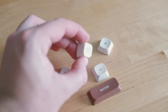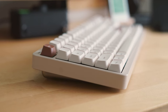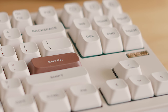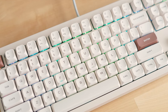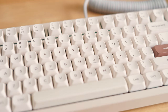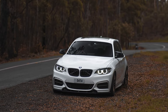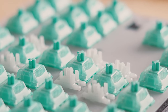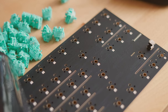But what do I think of the Gem 80? I mean, it's alright — jokes aside, yeah, it's a pretty great keyboard. However, there are a few things to note. The most important to me is the design of the keycaps. Innovation is good, but I think there's been some oversight here. The keycaps float slightly higher above the frame, so from certain angles you can clearly see the bright green switches, which is a bit off-putting. Combine this with the per-key RGB and bleed-through is not very nice — I prefer to have this off. And like I mentioned earlier, the clip-in stabs suck. It's just a really bad self-imposed handicap, especially if you're providing customization through multiple plate options — it would have been great to at least have the screw-in stabilizer holes.